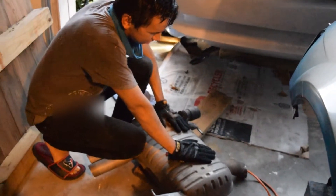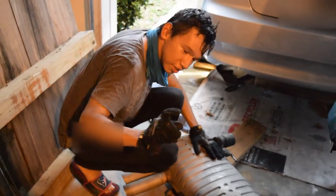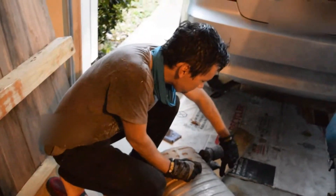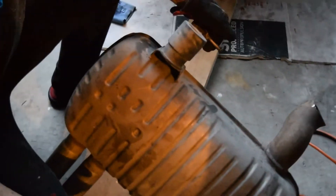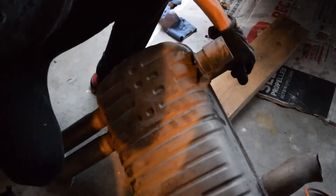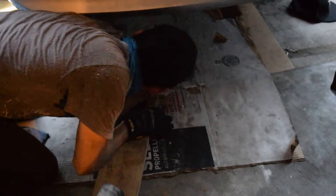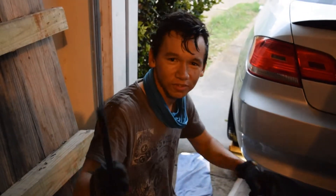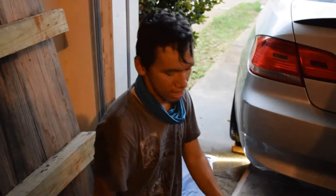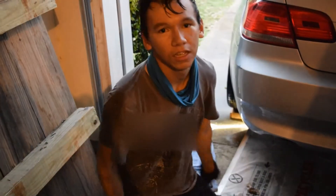Here it is — I eventually conquered. Important note: take off the back hanger that's located right here, because it's a lot harder to take it off when this part is already dangling. It has all the weight on that one. The way I did it was with a small tire iron — you put it inside the hanger and you push down. It gets the rubber off in the middle, and then you just keep moving it up and down and push, and that's how it comes out.